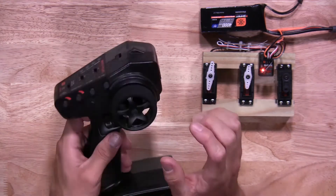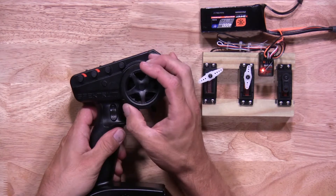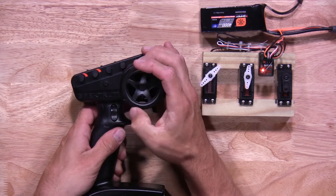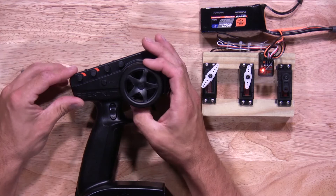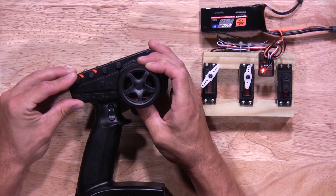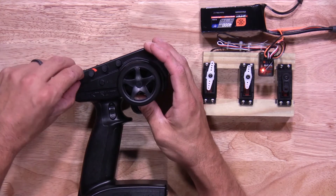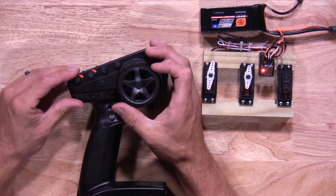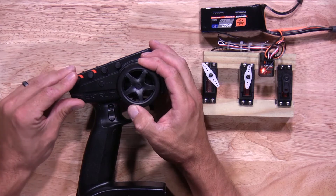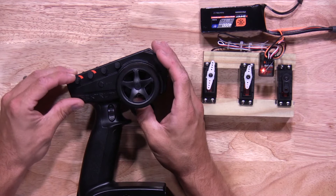The first thing we're going to do is steering, which is done by the steering rate knob. Let's check out our throw here — that's max throw. So we'll go full right and turn it down to about halfway. Once we're done with that setting, go back to 100% on your steering rate. Now let's do our left side — we'll go about halfway as well, then let go and go back to 100%.